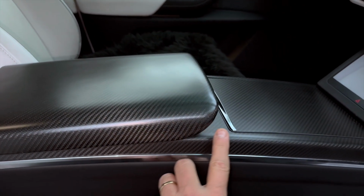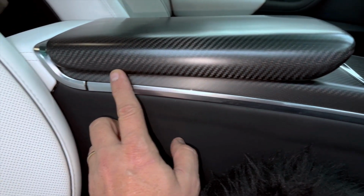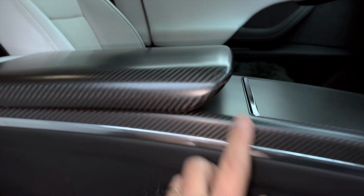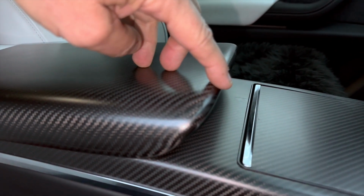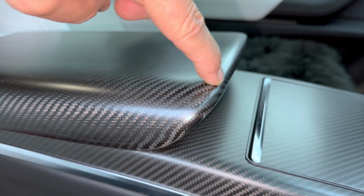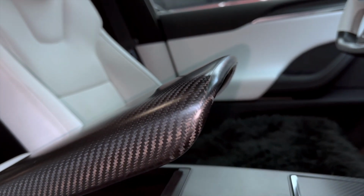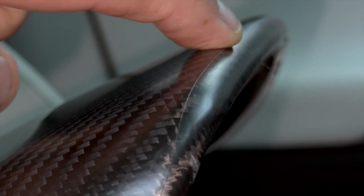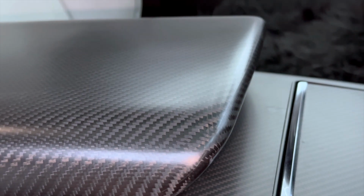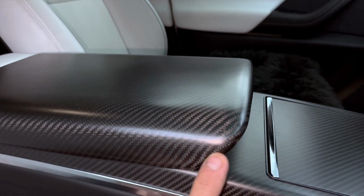So now this is completely covered and this is not. And the edge, here you can see the edge right along the bottom, all the way to the bottom, no air bubbles. And if you're looking at the front, the leading edge, again, we stop right here on this edge right at my fingernail, and that's the leading edge. Anyway, we just want people to say, well, it doesn't cover it, but yes, it doesn't cover it. If you're looking here, you can see this thin line that goes over the top. So it is a top kit. This edge is, like we said over and over, way too hard for a novice to install. Even the best clear bra installers here would have a problem with this. You have to shrink it a lot.